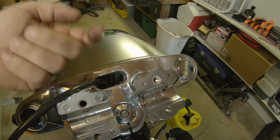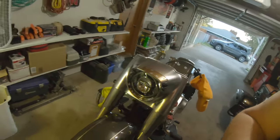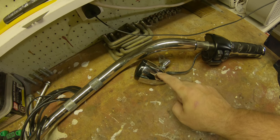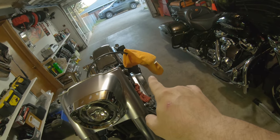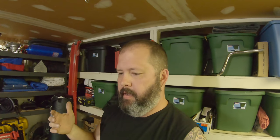Bars are off. I loosened up the clamp and fed the wires up through the hole. Did have to take the mirrors off because I needed to leave the blinkers behind — they were kind of attached to the levers. The controls are wrapped up nice and tight with microfiber so nothing gets dinged.